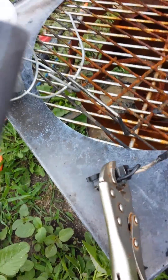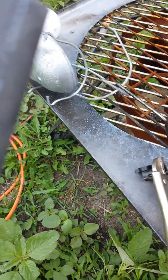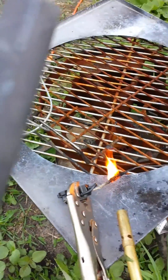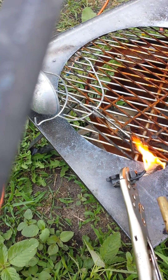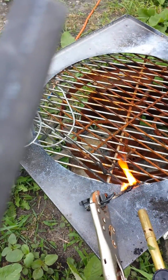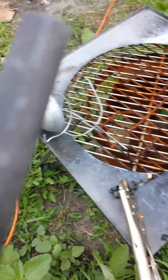What I'm doing is taking a torch and burning all the insulation off of here, being real careful as I get close to the sensor, not to damage it, but burn all this off and it turns to carbon. See like that. Alright, you can see where I've done it the whole way up.